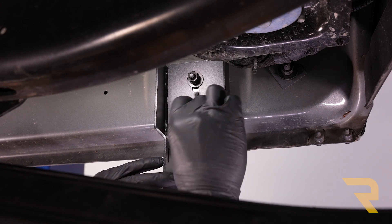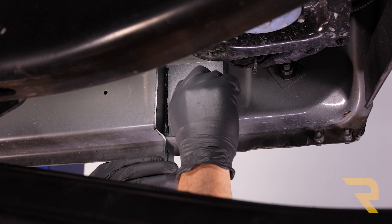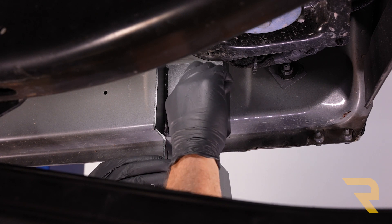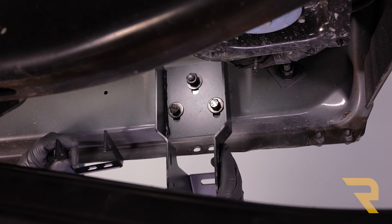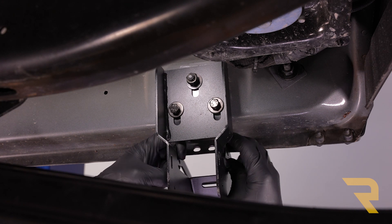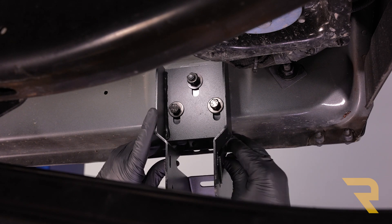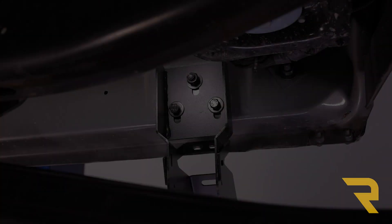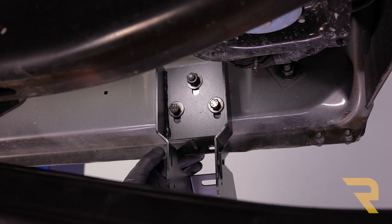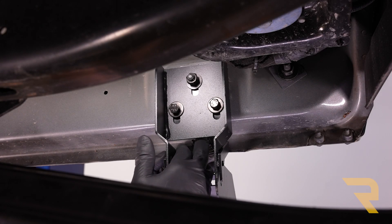Next, in the threaded holes, we're going to use an 8-millimeter bolt along with a lock washer and flat washer. Do that with each one of those holes. We're just putting this hardware on finger tight for right now. Next we need to go ahead and fit our support brace in. We're going to drop the bracket down, pull the support brace around the bracket, and push it up against our pinch weld. We're going to take one of our long bolts with a washer — this is our 6-millimeter bolt — go through the pinch weld and into that bracket, along with flat washer, lock washer, and a nut. Do the same thing with both of those holes in the support brace.